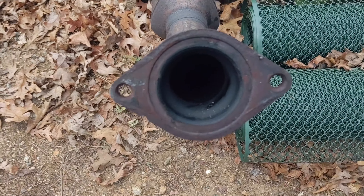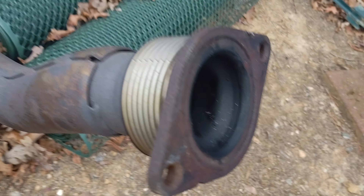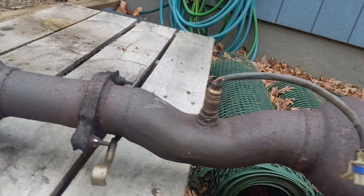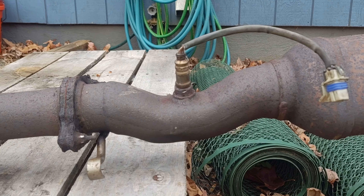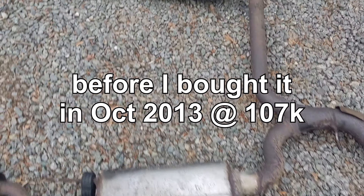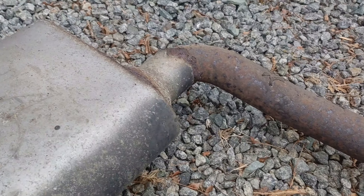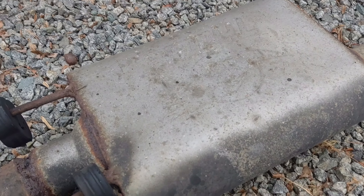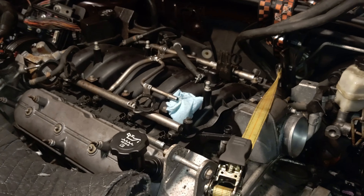The improvement here would be getting a downpipe, because looking inside with the light on you can see that donut really narrows down the diameter - the inside of that flex pipe section is pretty small. I really hate the fact they put a u-bend back in these cars after doing a little better on the 2004 Grand Prix 3800 redesign. I also learned what kind of mufflers someone swapped on this thing - they basically left the entire stock cat-back and just put Thrush mufflers on with a two to two-and-a-quarter inch inlet and a really cruddy outlet. This thing still sounds pretty good, but something to address if I keep it.